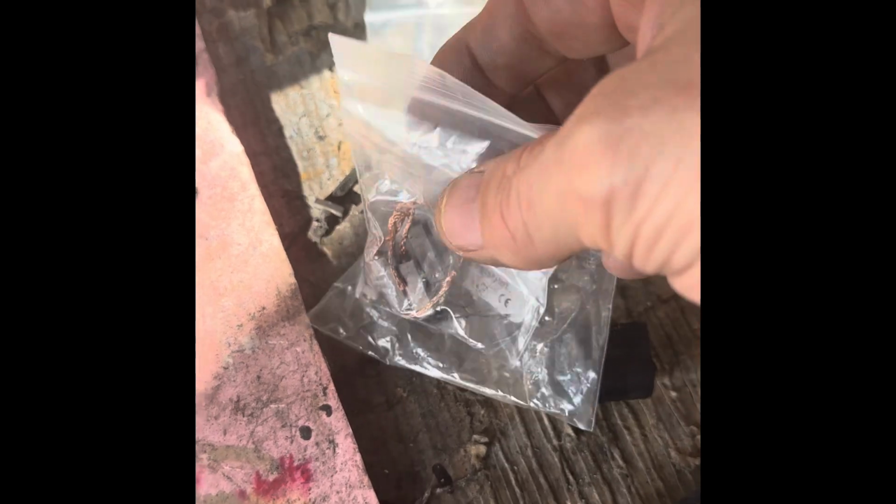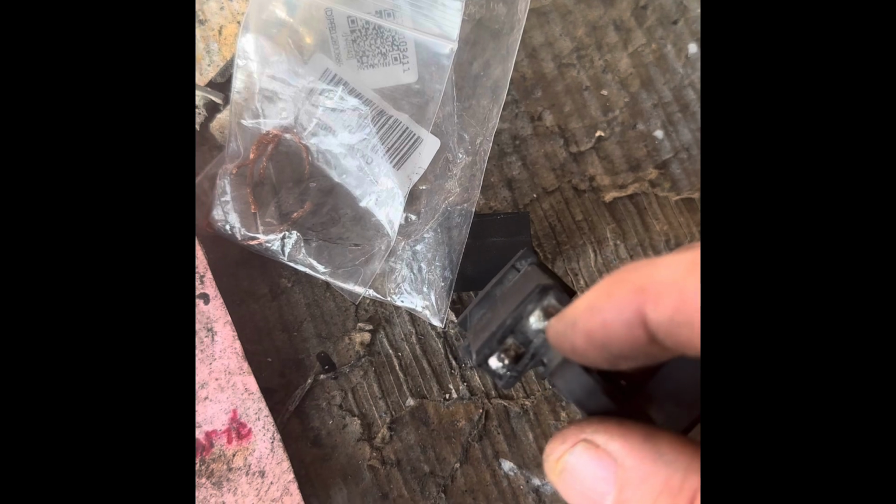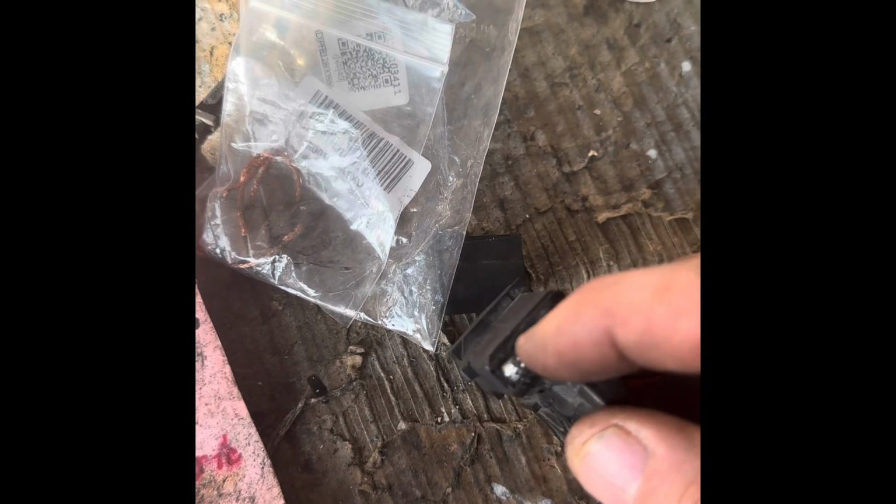We've got our brushes. I've got 4, give me a double set. So we've got to replace these brushes here. So what we have to do here, I mean, that's been soldered there. So what we need to do is grind out the back of that with a little, you can either use a file or something. I'm just going to use a burr or a drill.